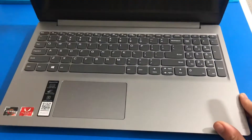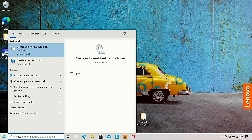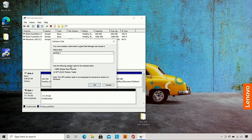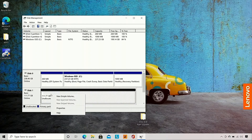So let us turn on the laptop. It booted up fine. What we are going to do is go into 'Create and Format Hard Disk Partitions.' Once you open this, it will initialize the SSD. It is going to show a prompt, and I am going to pick GPT. Shout out to the comments for mentioning that. I am going to click OK. Now we can format the new SSD — I am going to right click it and select New Simple Volume.